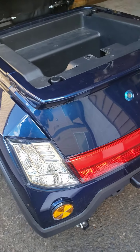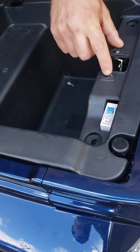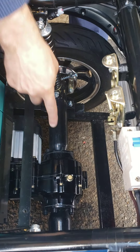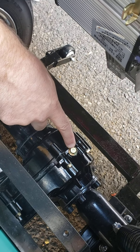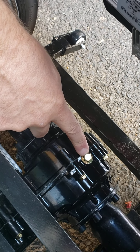First, open the seat and remove this plastic tray, which is held by only four bolts — two here and two on the bottom. Lift it up and now you can see the rear differential right here; it looks like a pumpkin. The fill plug is on the top, and on the bottom you're going to have the exact same shape drainage plug.